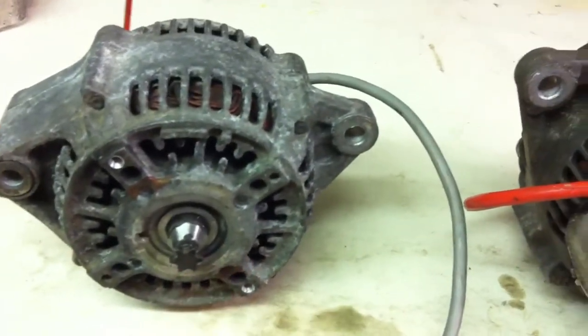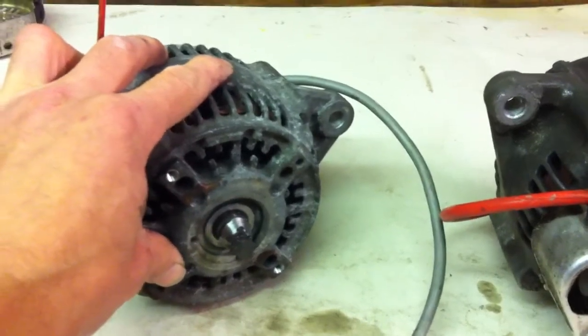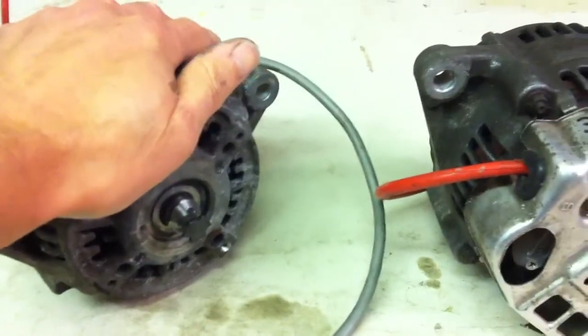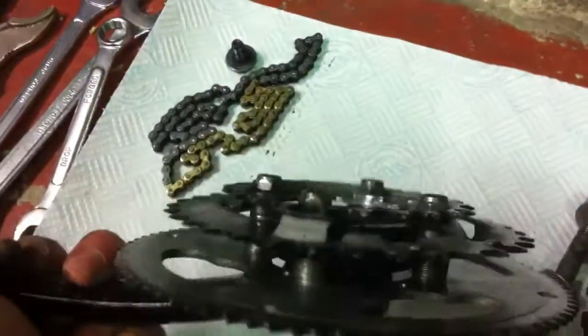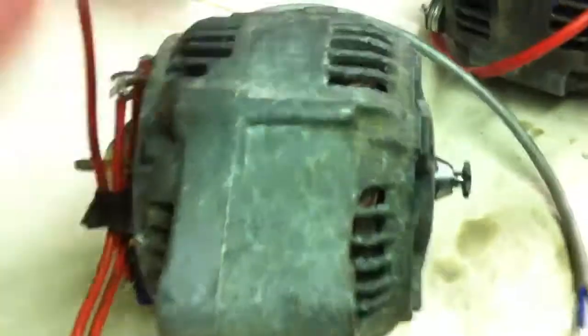Next video I'll install this and take it for a run. It won't go any faster — hopefully if they're exactly equivalent they'll go the same speed — but it will spin faster and I can use a higher gear. I may change the freewheel crank, which I think was a 22 or 32, and go for a 32 with a 42 or 40-tooth. The key thing is all the chain alignments are exactly the same, so it should be a straight swap.